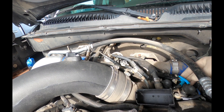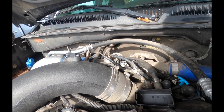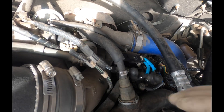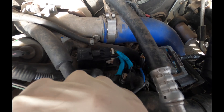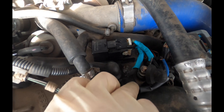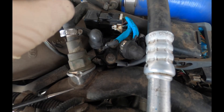There's a connector — that's the control side. I think we're missing something over here. Let me show you what happened. Right here we have power from the battery on one side of the relay. These are not connected underneath — they're just junctions because they're high amp current and need a good connection. This is the feed to the actual intake air heater — that's drawing about 46, let's say 50 amps. But this wire right here should not be where it is. This is the sense wire — you can see the duct tape. We actually need to move this terminal to the correct location.